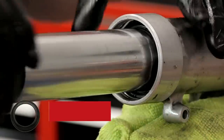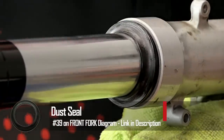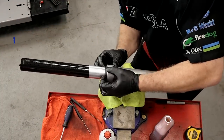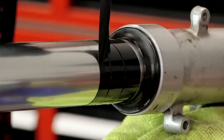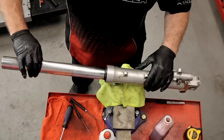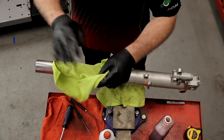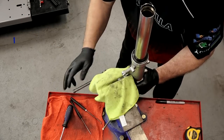You can look inside and see where that chamfered edge is just inside that groove - that's going to give us enough room to get this locking collar back in. Bring it down, being very careful not to scratch the fork tube. She is in. Last but not least, the dust seal. I think that is it - she is bottomed out. Now remember when we were taking this apart, how tough it was? Look at that - the way it should be. Vast improvement.